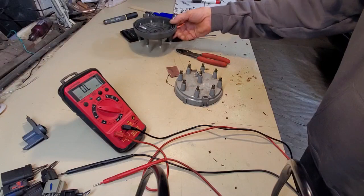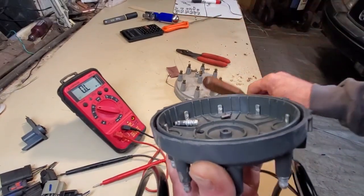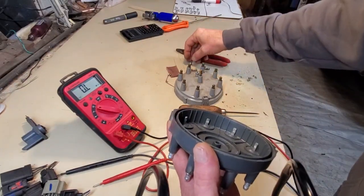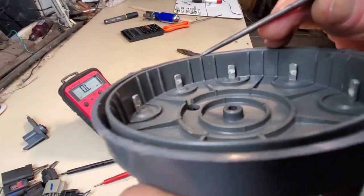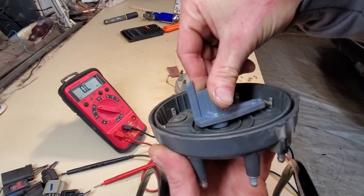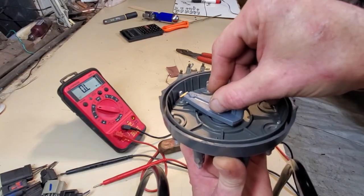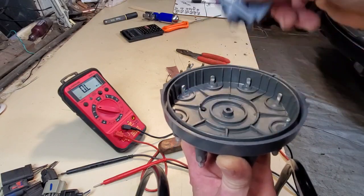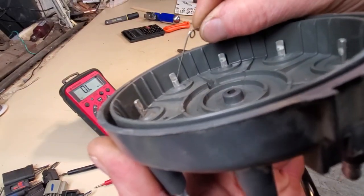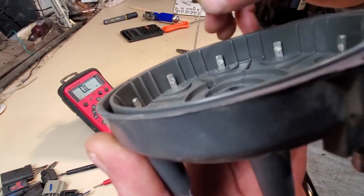Another thing you would have to do is, with your fine grit sandpaper, get rid of all of these. I might as well take my stuff out of here. Those parts. If you can see, remember we said the rotor button lives its life arcing to those posts. It's the best way for you to see that. As it spins around, it lightning arcs to these posts. And as a result of all of those arc jumps, a certain amount of the metal, this aluminum, is compromised, and craters are created, and divots and deposits are left behind. You have to clean up your contacts.